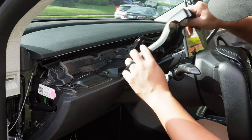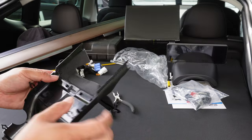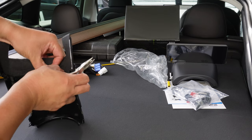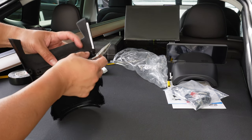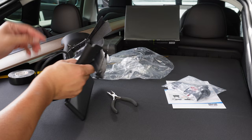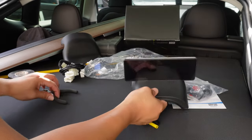Take your hand, grab the trim cover, and lift it up. There are four clips holding the trim cover to the steering wheel — take your time removing the trim, it's a bit harder than most trims. We will be reusing the soft leather part of the steering wheel column cover. First, detach the sides by unclipping it, then use the pliers to squeeze each of the four clips holding the soft cover to the base. This is a lot easier than trying to squeeze the clips with your fingers. Then take the screen and attach the soft cover to it, and be sure to re-clip the sides onto the cover. Grab the wires and let's get this installed.